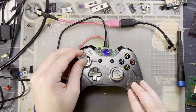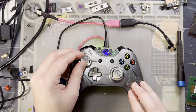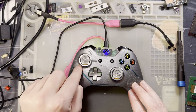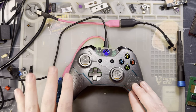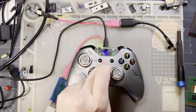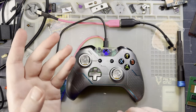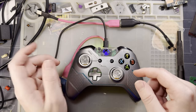If your sticks wear out, you know, you get mechanical wear in the mechanism, it's not centering properly, stuff like that, you could pull the whole stick box out, but leave the potentiometers in there and then install the new stick box. There seem to be plenty of reasonable aftermarket ones as long as you keep your original potentiometers. I didn't do that with this, which is why I've swapped it over to the Hall Effect, because the alternative is you install one of those little aftermarket potentiometer tweak kits, but then you lose your full range of motion.